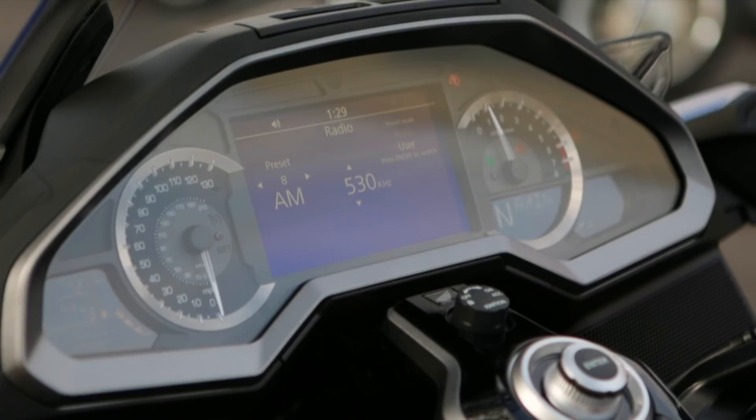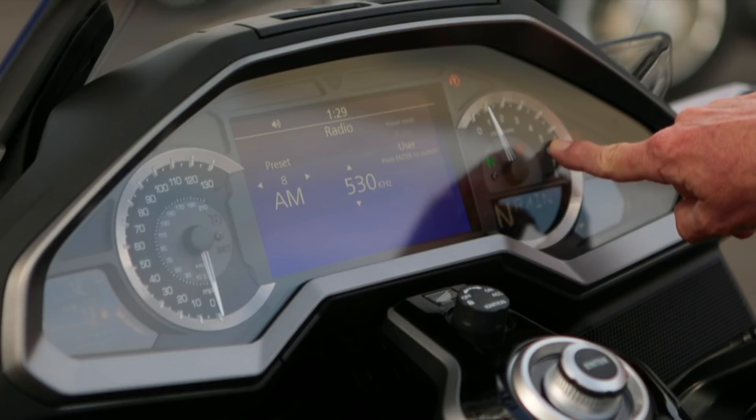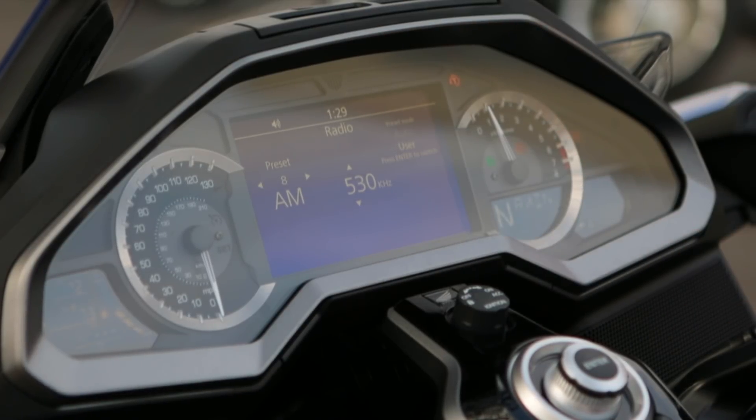One of the coolest things here — I see this little tiny motorcycle that looks like it's pointing up a hill. Believe it or not, this is called hill assist. You no longer have to worry about whether you can feather the throttle enough to keep from sliding backwards. The bike knows when you're on an incline and will not let you roll backwards — you give it throttle and off you go. How many tense moments have we had with that, folks?